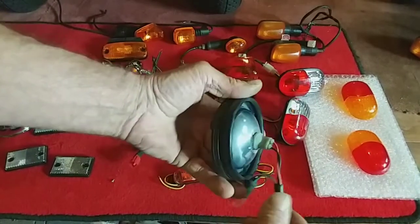I've plugged them in and turned the ignition on - I should have two red lights on the right, yep, and one on the left. I've not bothered doing both sides - this is just to give you confidence that I know what I'm talking about. And then you should have indicators. I've got a bulb gone on the left hand side - I've replaced that, that was just a bulb out. So that's lights on and off - two on the off side, one on the near side. And then indicators, near side, off side. Lights on - no problem. And hazard warning lights.